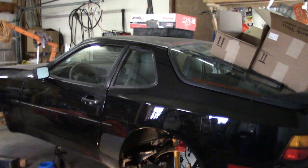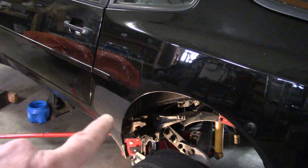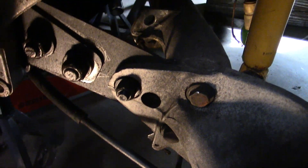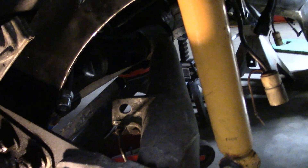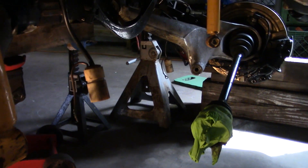One thing I completely forgot about being able to remove the torsion bars from the back of one of these things is that the control arm actually needs to be unbolted. So these three bolts have to come out, and I don't know if I can get it out of the way — probably not. So that means I'm probably going to have to go up under the car and see if we can shed some light on this.